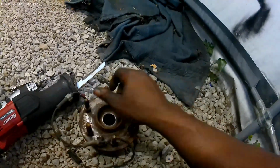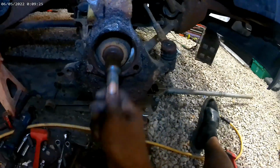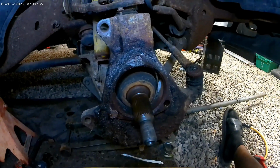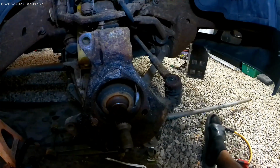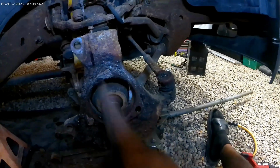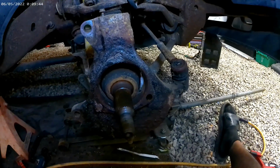What you're gonna want to do is remove that hub bolt, axle nut, so you can just push this back a little bit, and then you got 1, 2, and 3. But we're gonna get these knocked out of there. Stay tuned. So far, that's how you remove a hub assembly. And we'll go back on with the new one if we can find the new bolts tonight. But so far, I'm gonna clean this up, and that's how you remove that thing, man.